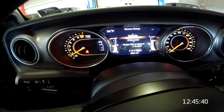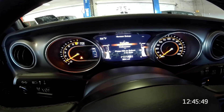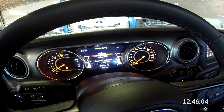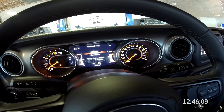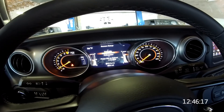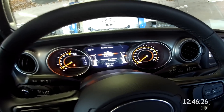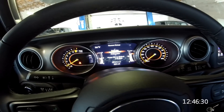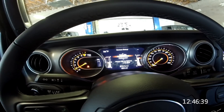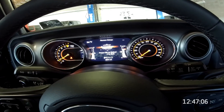In drive it's only allowing me to choose one or two gears — I'll have to check what the actual strategy is. This is a ZF 8-speed, and the one installed behind the Pentastar is rated for 500 Newton-meters of torque, which is just over 360 foot-pounds. I'm not sure I'd want to put a V8 in front of this particular transmission. I'm told the diesel will have the beefier ZF 8-speed that could probably handle a V8. If we're talking an LS3 — which makes around 450 foot-pounds of torque — I would not put an LS3 in this JL anyway, partly for legal reasons since the LS3 was essentially phased out in North America in 2015, and the JL is going to continue to be built for probably another eight or ten years.